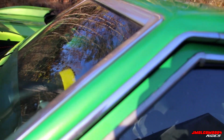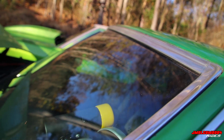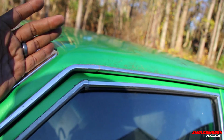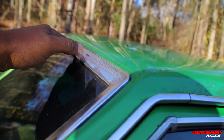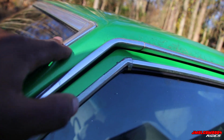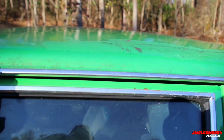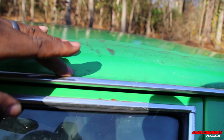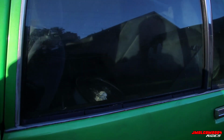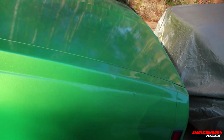Check this thing out. Check your chrome trim, cause I didn't throw that in the other video. Push down on it. Make sure it's secured, cause if it ain't, this stuff will fly off and go down the road. Now you need some chrome trim because they got clips on there. Sometimes they go bad, they get old, and that's that. So you want to check these, just lightly push down on it. You ain't trying to put a lot of pressure. You don't want to break the clips. You don't have no top, so you have no rust to worry about. Like I said, with the full vinyls, I told you what to check on them, but you ain't got no top on here, so you can just inspect that. A hard top car, body usually pretty good to inspect.